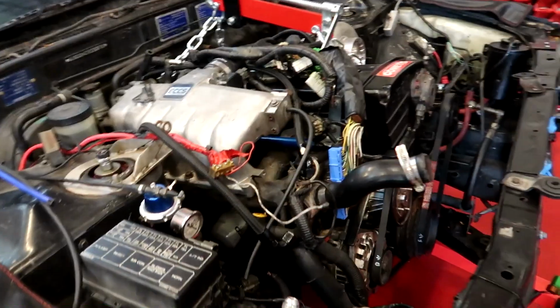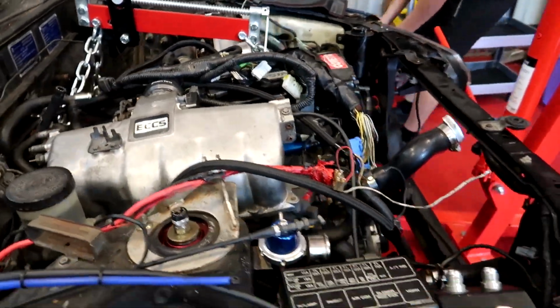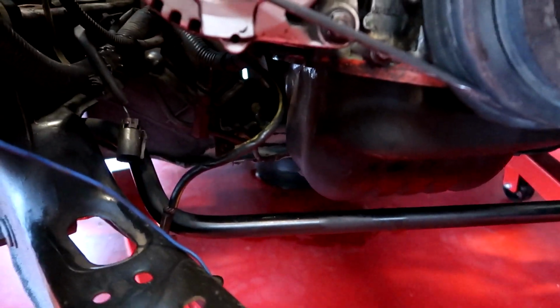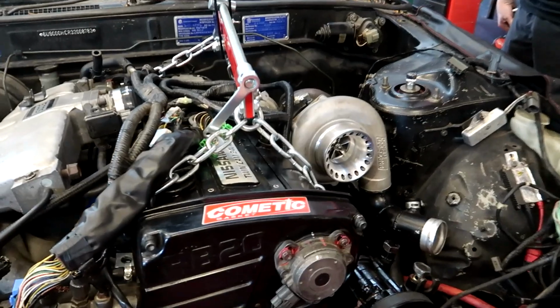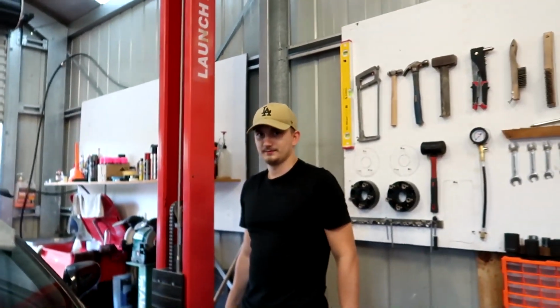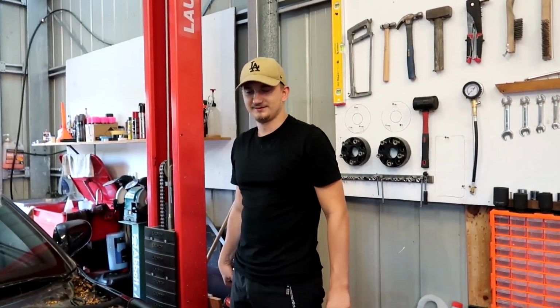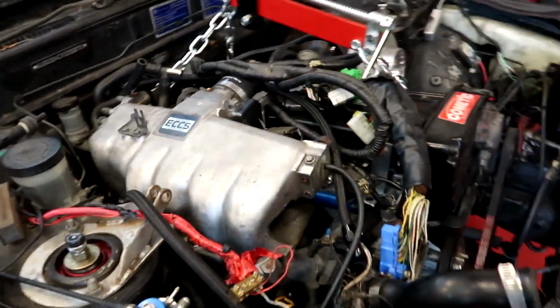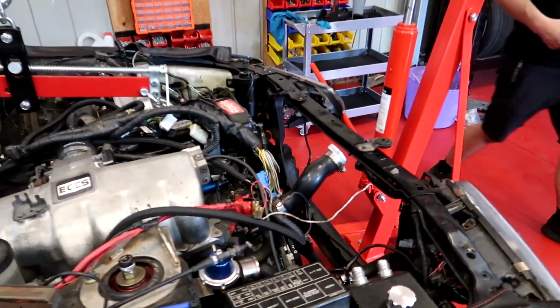So it just took a little bit of jimmying, and then to get it in the exact spot, you want to line up the engine mounts and be careful not to drop it onto all the power steering lines and the power steering sensor plug that's there in a shit spot. But when you're doing this, things go where they need to go, and if it doesn't quite fit, just pull it out and readjust. Make it fit. Well, we knew it came out of here, so it had to go back in. Exactly right. It's come out, it's got to go back in.